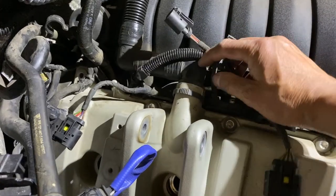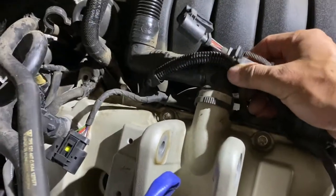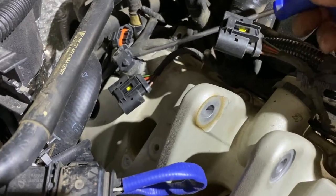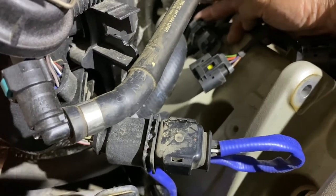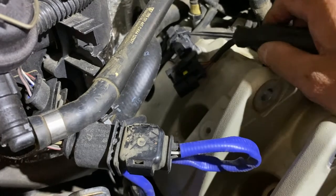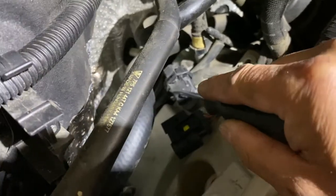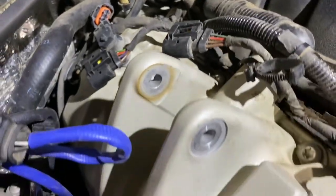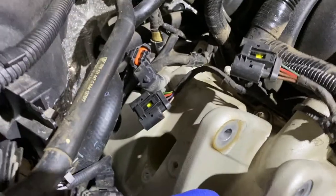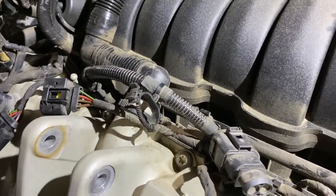They also, notice there's a vacuum line, vacuum hose, which I will press and pop it out. And remember this one. So if I can't just put it there, what I did is I kind of pry this little tab. Just use a screwdriver lightly. Tap it up and kind of notch this off. So by doing so, now they're disconnected. And once I remove the vacuum hose, I should be able to remove these three big bolts and attempt to separate the valve cover.